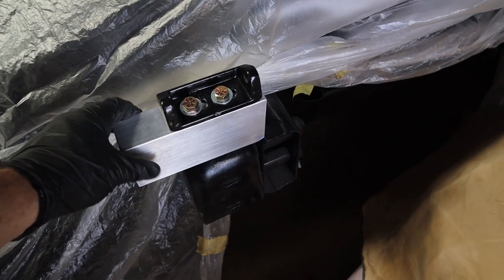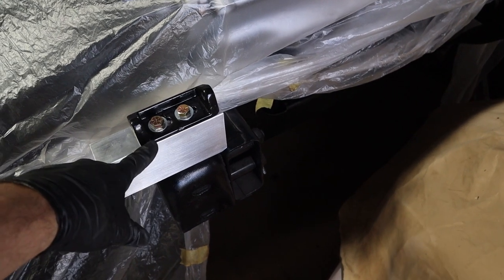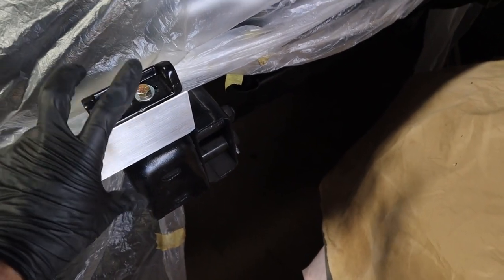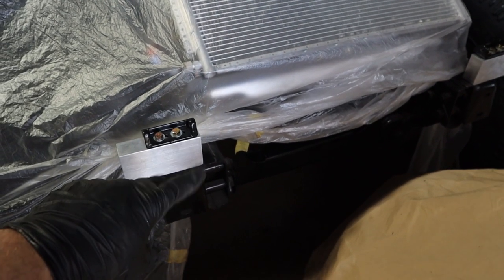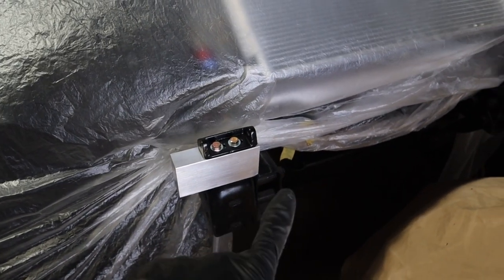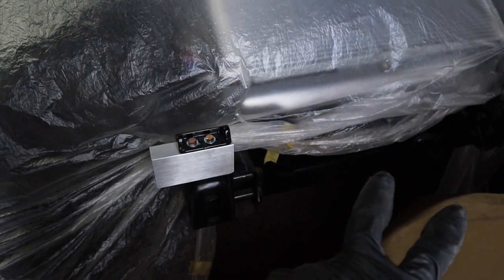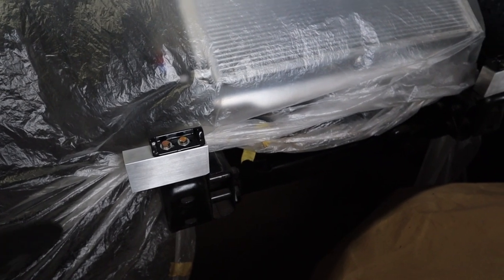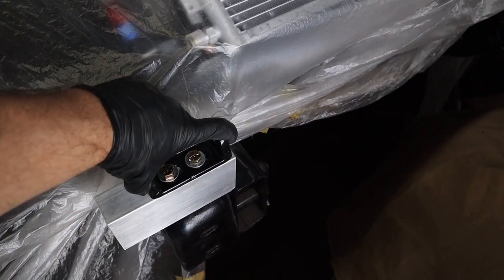We got our hood hinge spacers here. I want the hood to actually hinge up top instead of at the bottom, so I'm going to put this here instead of on the hood — that way it'll hinge right here instead of hinging down here. We are going to have a gap there but I have plans for that. I went ahead and pulled out the bumper; I need to get that sanded so I can get it painted. I'd also like to put a winch behind here, so I either need to order a winch plate or make my own, but I can do that after I get the hood on and know all my spacings. These are loose right now — I need them loose because once we put the hood on we'll probably need to adjust them a little bit.